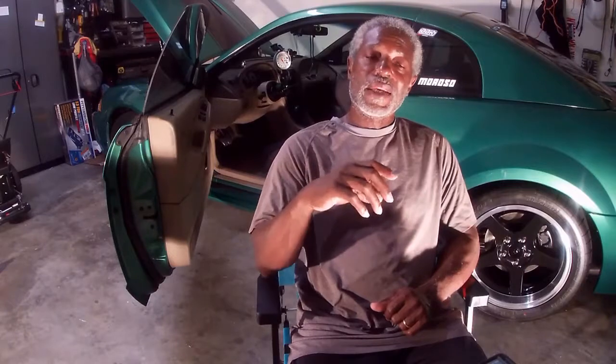And you're going to have to take off the front tires. You're going to have to take off the brake calipers and the brake caliper holders. You're going to have to take off the rotors, and tie the rotors up out of their place. You're going to have to take off the fender shrouds. Then you're going to have to loosen up everything on top and everything underneath the car that is going to be in the way of dropping the whole K member. There are 8 bolts that hold in the K member. There's going to be 2 where the shocks go up into.